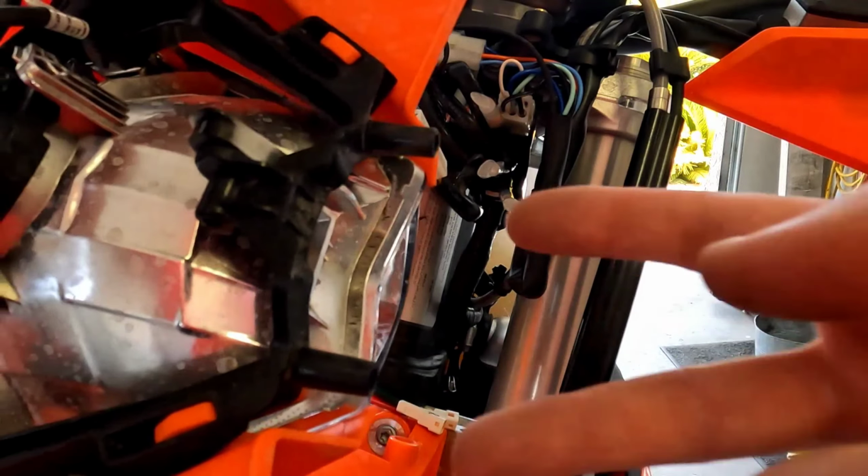As we make our final connections to the headlight mask, there's several things I want to point out. When we're talking about the orientation of the turn signals, or at least the connections, Taco Moto is sending these to you guys with a R and L, right and left. So think of that as which way you're selecting to turn. When you're selecting the right turn, selecting the left turn, that's the side signal you want. Don't try to think of it as I'm sitting on the bike or as I'm standing in front of the bike, because I know sometimes people will do it either way. Think of it as which way you're trying to turn, right? So in this case, when we want to turn right, it's that signal on that side of the bike.